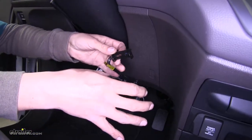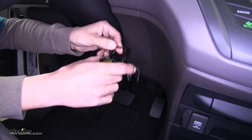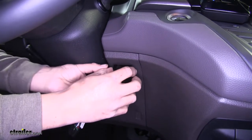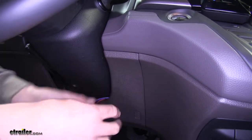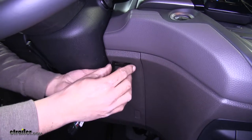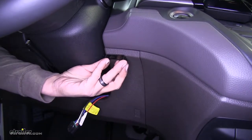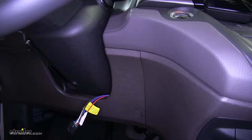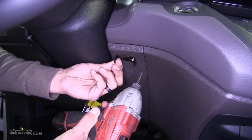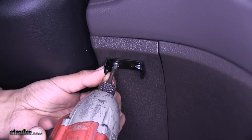To mount the brake controller we have a few different brackets, but we're going to be using this detachable style one. It's going to mount to this small bracket and then the small bracket will mount to what's actually going to hold our brake controller. When we go to mount our brake controller, the really only big concern is that it's going to be on a level plane — you don't want to have it cocked to the side either way, but the angle isn't a big concern. Get your bracket in nice and straight, take some of the screws provided in our kit, go right into the plastic, leave one a little loose so you can get the second one in nice and straight, then once you're sure it's straight, go ahead and tighten it up.